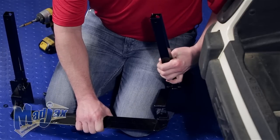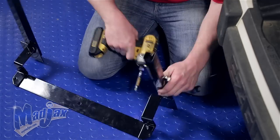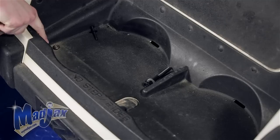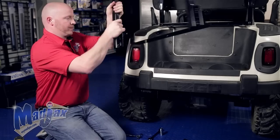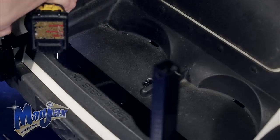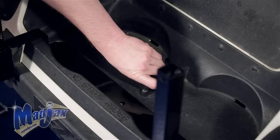You'll notice that the Bagwell bracket and the Bagwell support bar have the same angle on the outside corner. Now we're ready to attach our Bagwell bracket to our golf cart. First, we're going to remove the two factory bolts here and here, but do not retain. We're going to take the six millimeter hardware and attach the Bagwell on the outsides first, then use the 10 millimeter hardware and the two by two square washer to secure the center of the Bagwell bracket to the cart.